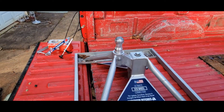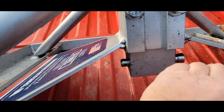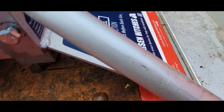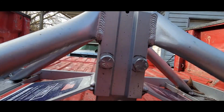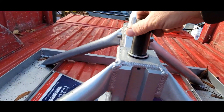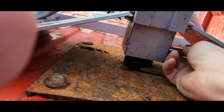It's going to go in with the ball toward the back of the bed, because this goes over the gooseneck ball. Pull the pin here, take this one out, slide it up and let it fall over the gooseneck ball. I need to see if the pin will go through — if not, I'll have to undo the top bolt a little more to let the sleeve come down far enough. I went and grabbed a 15/16ths socket on my torque wrench and I'll unscrew this until it drops down far enough so I can slide the pin in around the ball and lock it.